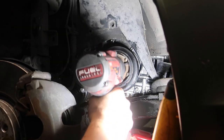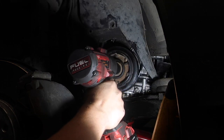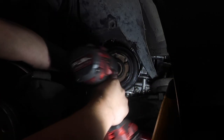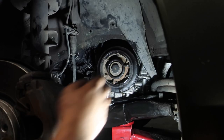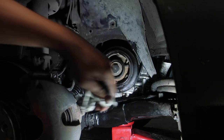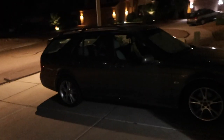There you go, just like that. Put the torque gun on the second torque setting — it doesn't need the whole way up like 300 foot-pounds, it's not that much. Beautiful. Now we'll reinstall the belt, the motor mount bracket, everything in reverse order, and the car is all back together.